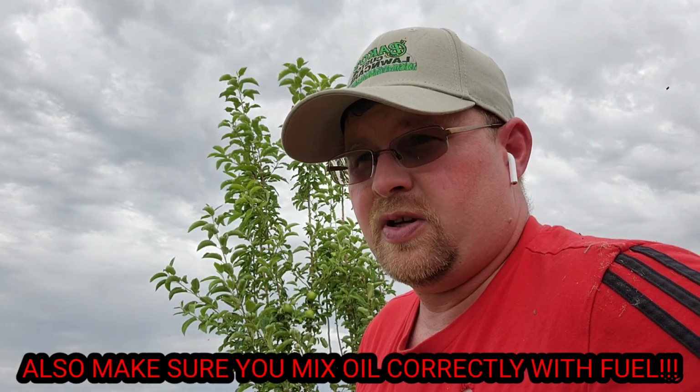Now, obviously in the fall and spring, you don't have to worry about it. You choke it just like normal, and it works fine. But when it gets 100 degrees, when it gets over 90, you don't need to choke it all the way. You just need to flick it to that second setting.